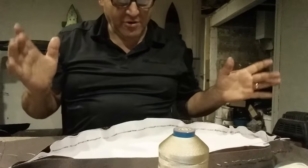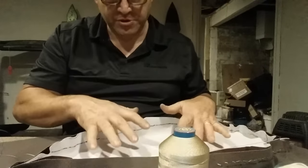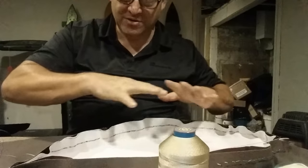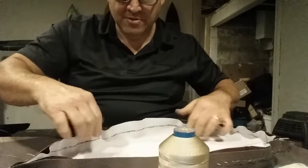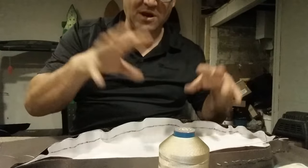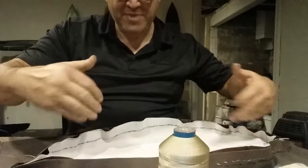I got a good part of the first French seam done. I cut my material a lot larger than it should be because then I can always adjust where my hems are going to go by stretching the vinyl with my heat gun. I got a line here — that's the center — and then I put another magic marker line on this. I'm using the snakeskin for the outer; I decided I don't want it as an inner. I'm putting the chestnut as the inner and the snakeskin as the outer. I kind of like it better that way because I don't really like to see a repeating pattern — it doesn't look real.